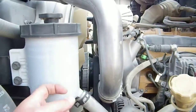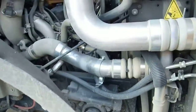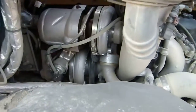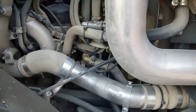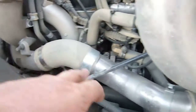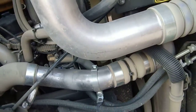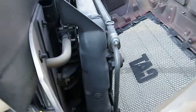This is the power steering fluid reservoir. There's the coolant tank, and the air cleaner is in this box. This engine has compound turbos — the smaller one on top, bigger one on the bottom. I also noticed it has two air-to-air intercoolers. This one in here comes off the small turbo, comes back around into the big turbo, and then into another air cooler up on the front right-hand side.